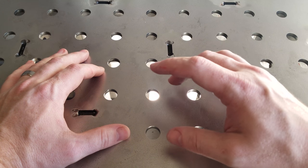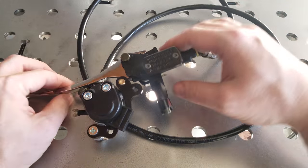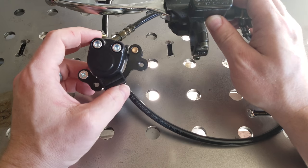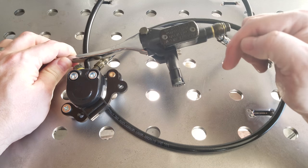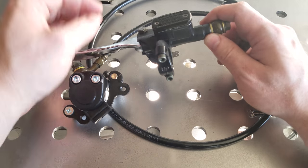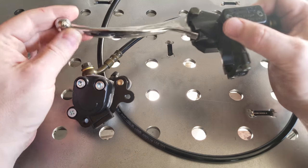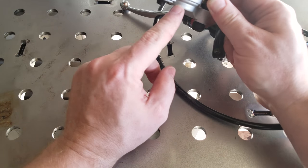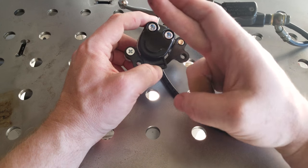I also purchased this one piece because it also gives us a switch to run our brake light on. It is a hydraulic closed system for the rear brake. This particular one is from OMB Warehouse — I'll put a link down in the description. It comes pre-filled and should be a bolt-on for our Doodlebug. It comes with the brake lever, the master cylinder, the caliper, and the line.